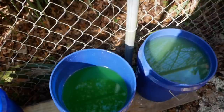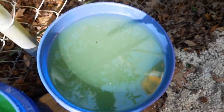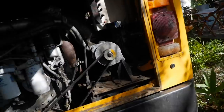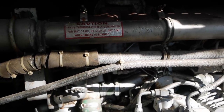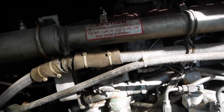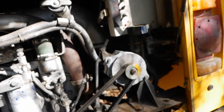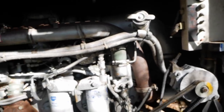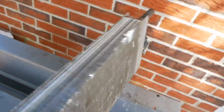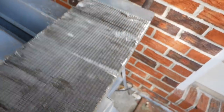I did four coolant flushes — here's flush one, very green; number two, three, and four. There's still a lot of green in there. My engine temperature gauge at the front of the bus is not going over 145 degrees, which I think indicates the thermostats are not opening and not letting coolant flow to the front. I also removed, cleaned, and flushed the heater core for the front of the bus.